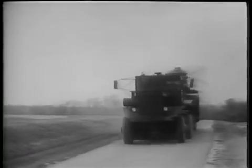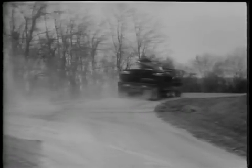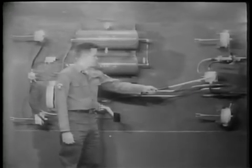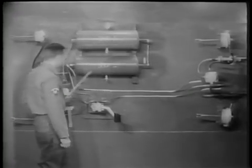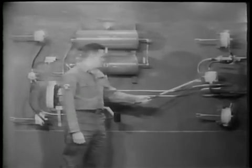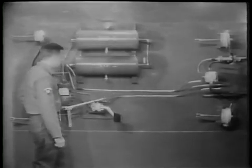On long wheelbase tractor trailers, the front brake chambers are close to the brake valve. The rear brake chambers are a long distance away. Yet the rear brakes must be applied at the same time as the front brakes and must release as quickly. The relay valve provides quick response for the rear wheels. It provides a direct compressed air feed from the dry reservoir to the relay valve and then to the rear brake chambers. This air feed is regulated through the control air line by the brake valve. Here is the action that takes place.